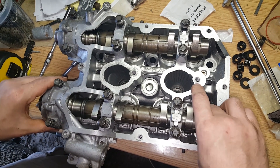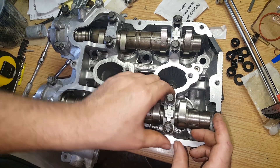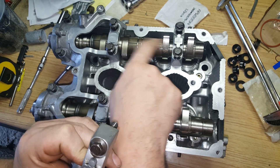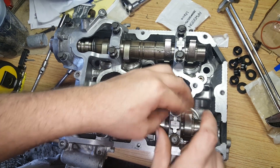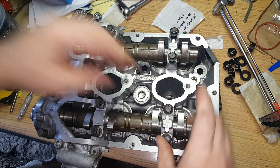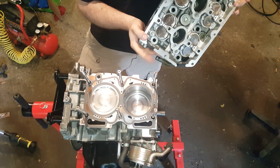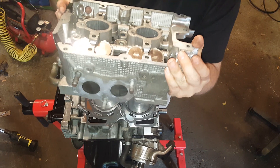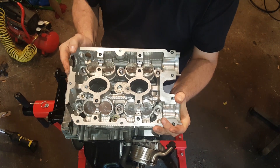We're getting ready to put the heads on now. A couple of things I learned that I thought were pretty cool about Subaru heads: all of these little bearings have a number on them and it matches to the head, and there are numbers on all the different parts so you don't screw it up. Also there's an arrow which always faces forward — you want to make sure you keep all of these in the right position. Got the head gasket on. We bought our gasket kit from eBay — the ITM gasket kit — it came with everything.